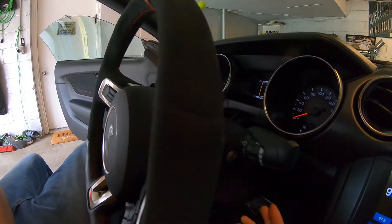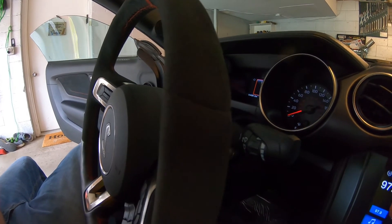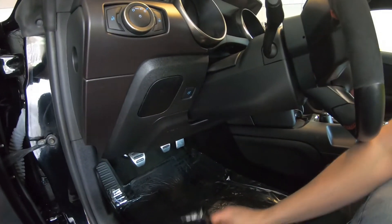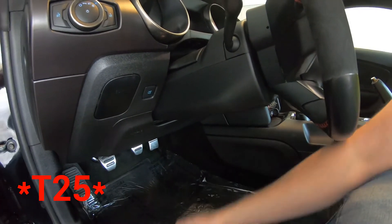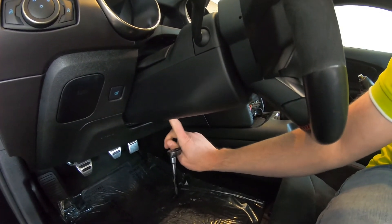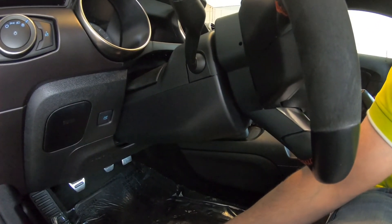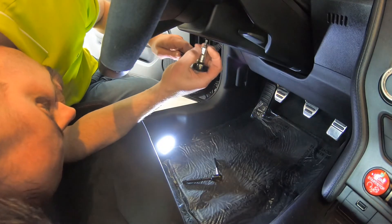We're going to take these plastic covers off here and then hopefully two bolts behind here, pop that guy out and put a new one in. For tools, it's pretty easy — we've got a T20 Torx for the front bolt up here, and then we also have a 7 millimeter for the bolt in the back plastic. It takes two different styles. I'm going to take those bolts out, separate the plastic piece, and get to the switch.